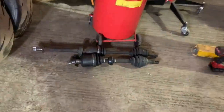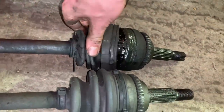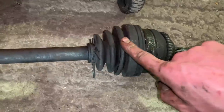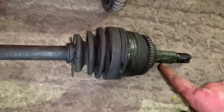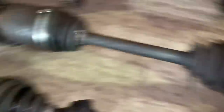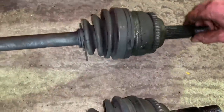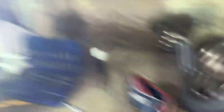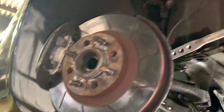Now to put it back together, but I need to fix these crappy CV boots. I swear I used to be able to get away with using cable ties before, but for some reason CV boots have got strong in 2019 - they just don't like cable ties anymore. It used to definitely be safe on the outer CV with a cable tie, but now nobody wants it. I want a metal clip, but I've not got any metal clips, so I'm going to try and bodge something together. Then we'll get this back together and change these discs - that should be a nice easy job.